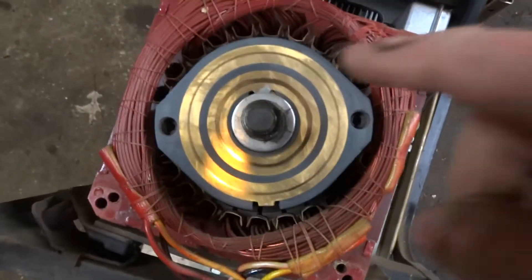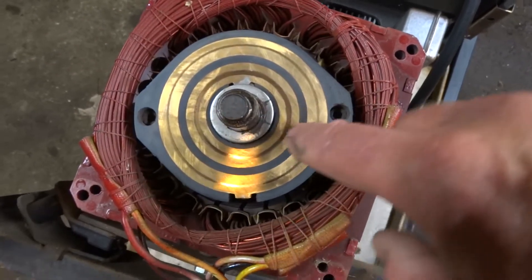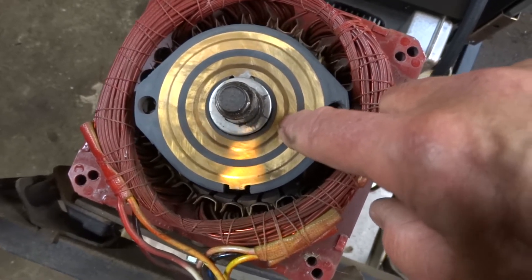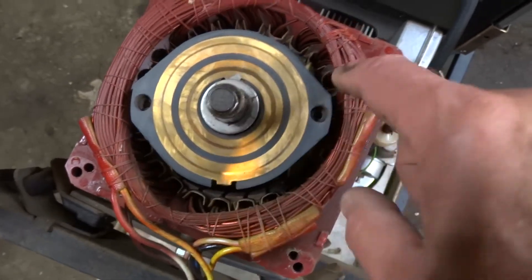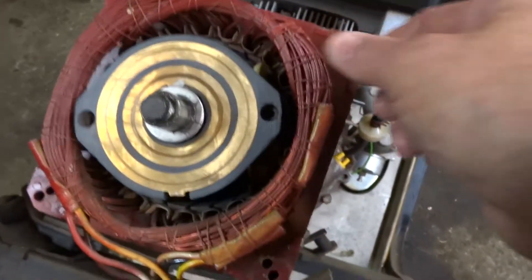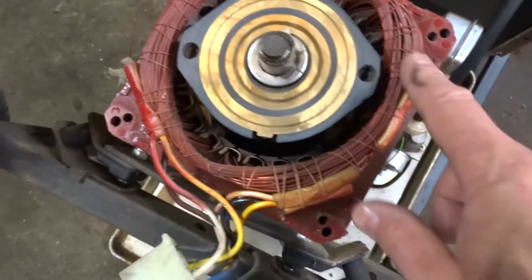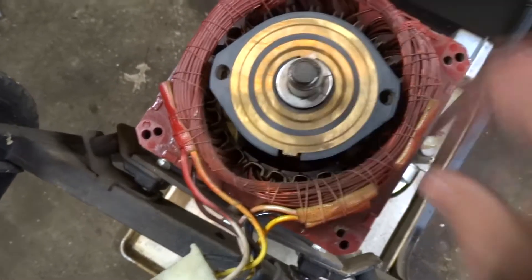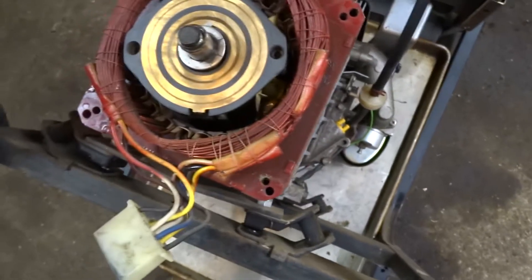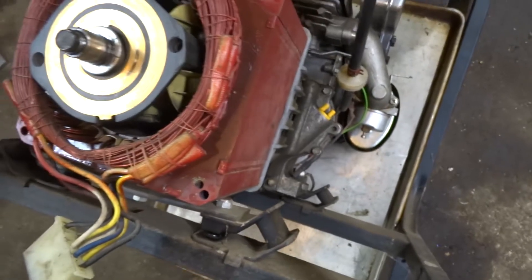See that little line right there, and that wider line right there? That's where the brushes are running, and I don't think it's making enough contact. I've checked out the windings here — I don't see anything burnt, so I don't think that's my problem. It was working, and then it just quit. The time before that, it had something to do with this here, but that's been a few years back and I can't remember what was what.